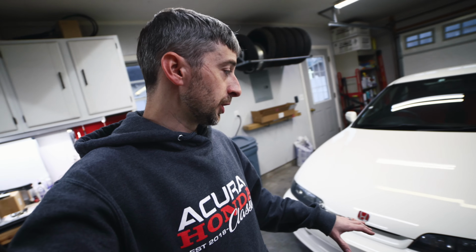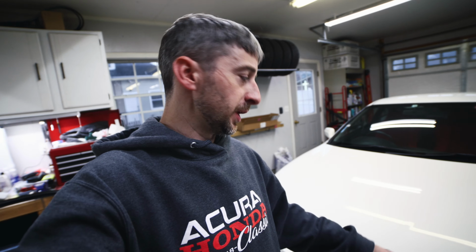So I'm really not going to recommend doing that acetone vapor restoration because long term it's probably going to do damage, and you really have to be careful. You really only should do one pass most likely. Otherwise it's going to damage the acrylic or the polycarbonate, whatever these are made out of, and you're going to get those cracks just like you see in some of the older headlights that have the UV damage.